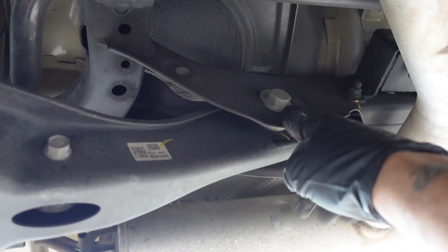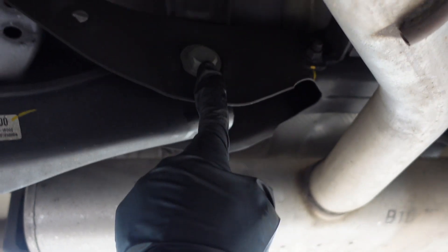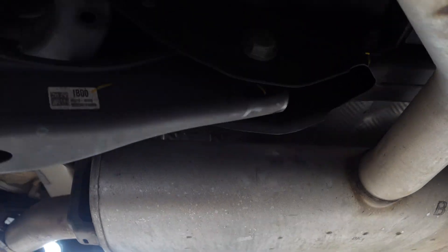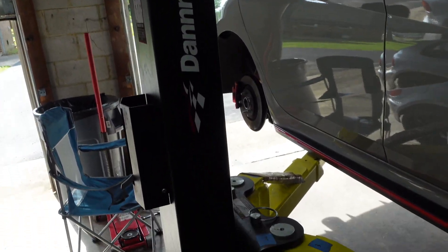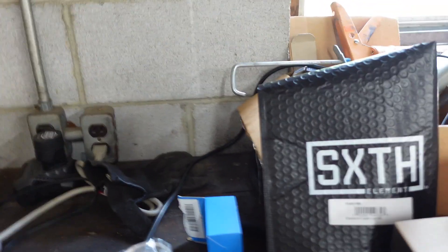Coming to the back — this is the rear suspension. You have two adjustments you can make: your toe adjustment is here and your camber adjustment is made here. This is just a rear eccentric bolt. All you have to do is loosen up the nut on this side — this one is a 19 and this is a 22 — and then when you rotate this eccentric bolt it's going to push this whole lower arm to the left. I'm having some issues with the rear camber adjustment though; I'm going to need an alignment machine, so I'll have to drop this off to get aligned.